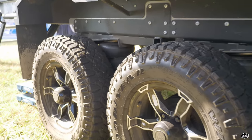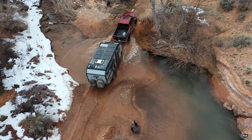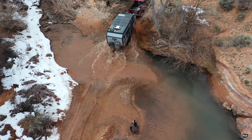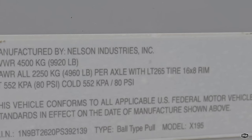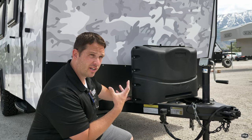It's a combination of things — typically the weakest point is what the trailer should be rated at. Even if the suspension and shocks are rated for 10,000 pounds but you have tires only rated for 8,000 pounds, you don't want to put it over 8,000 pounds. You can upgrade tires and other components — these are the technicalities behind how they figure out weight ratings. But you shouldn't have to worry about all that; just go find that sticker that says GVWR and that'll give you the weight rating.